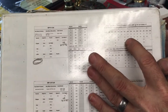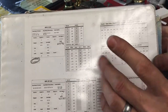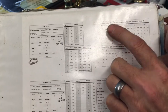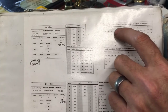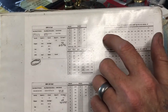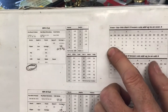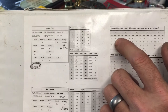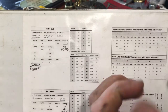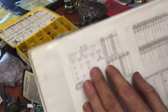This chart here was used for if you have the glove box lock — your next-to-last cut. If you have wafers two through six known from the glove box and your number two wafer was a number one, you use this chart. If your number two or number three wafer was a number two, you use this chart, and so forth. This is your first set of keys. You cut the missing cuts, try one-one, then cut the one to a three, making it one-three, then two-three — that burns your first key. If that doesn't work, cut your known cuts again and go two-two-four-two-five-three, cutting it deeper. If that doesn't work, you have your third final possibility.